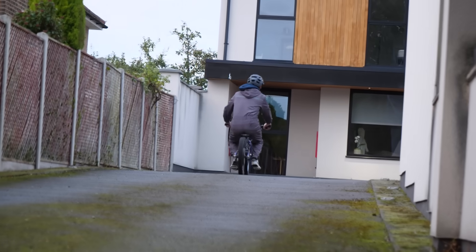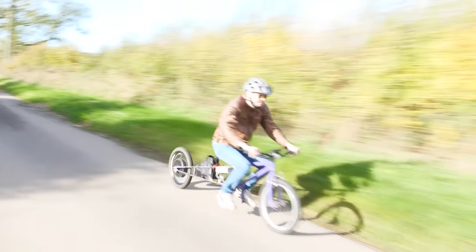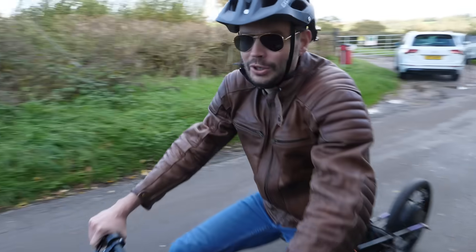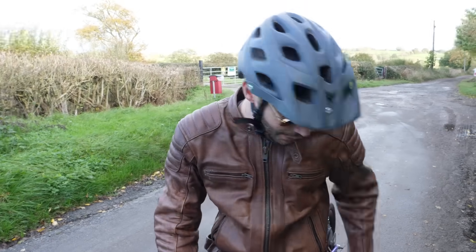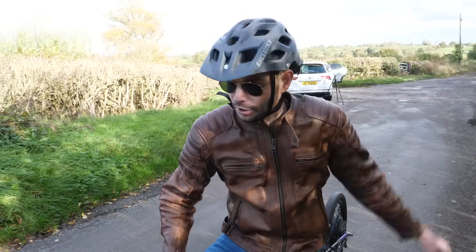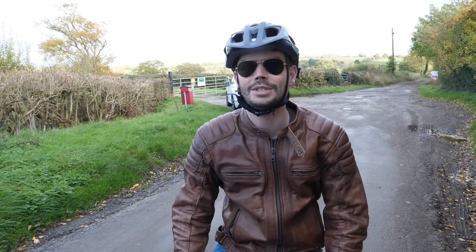Wheelying wasn't an issue anymore, but we did need more room to test it. We've got a couple of issues. One: it's windy. Two: the brakes — I think they've overheated. When I came back down, that was me at max brake the whole way and it didn't work at all. I could smell it as you came past. And also there's a lot of wheel spin. And last of all, there's a really bad speed wobble at about 50–60 kilometres an hour.